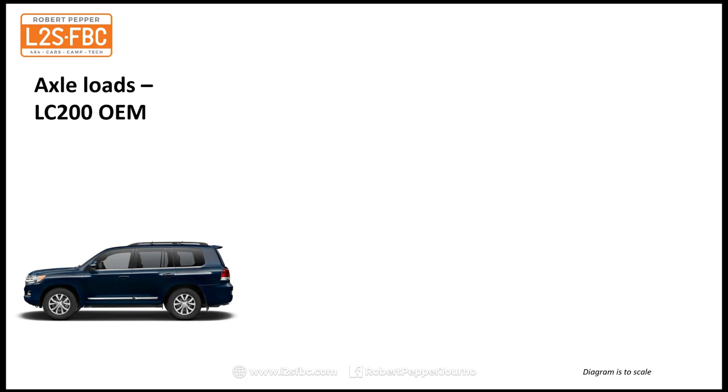Okay, now we need to take a look at axle loads because they're really important for understanding GVM upgrades. So we'll take the LC200 again, we'll keep with that, and we'll look at the OEM specs. So the maximum weight on the front axle you can put is 1630 kilograms. The maximum weight you can put on the rear axle is 1950 kilograms. Now that gives us 1630 plus 1950 is 3580, and a GVM is only 3350.